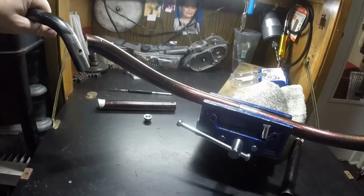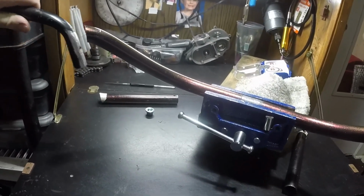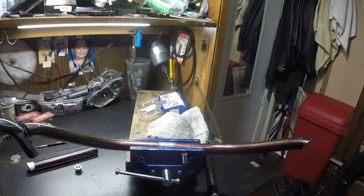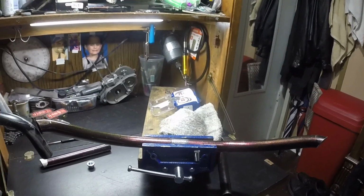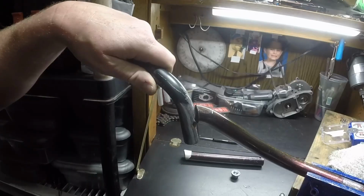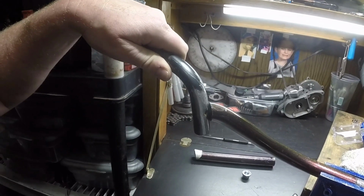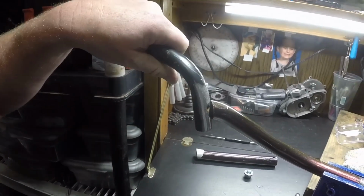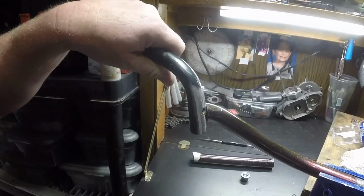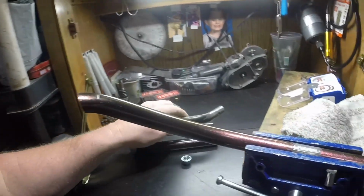I prefer to have my hands out more flat, not totally flat, and I like a little bit of curvature, but not flat bars, because then my wrist goes the other way. I've broken my left wrist 3 times and my right wrist twice over the years, so they don't bend properly anymore. So I'm gonna grind this out so this can fit in there on an angle, something about like that, but then that will let this metal wrap around this, and that will allow me to have something good to weld to, and it will make my bars somewhat custom.